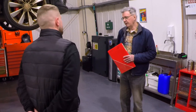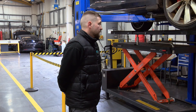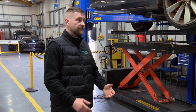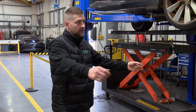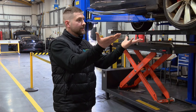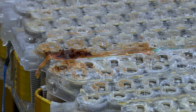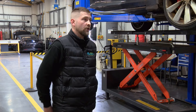Water can get in through the ways already described, but what about condensation? I don't know whether these are built in a dry room when assembled at the factory, but because of the temperatures rising and falling inside, condensation definitely seems to be a problem. All the modules and cells have a little plastic outer case and that starts to act like a greenhouse — moisture clings to the top and once it gets into a drip it flows straight through the module. It tends to be the front modules most affected, but we have seen corrosion all around the pack, which would be more condensation-related.